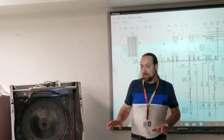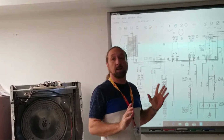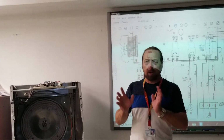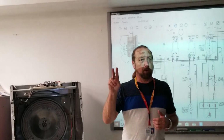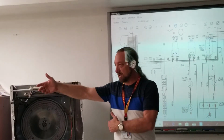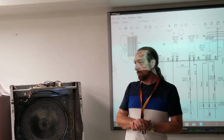Gotcha. I'll give you an example. I still remember this young man. He was working on a microwave. He says it's running and it's not heating. He was just getting into microwaves. He knew enough to test components and everything. I said, do me a favor. Tell me if you got power to the high voltage transformer. I need to know whether it's on the control side or the high voltage side of my problem. I need to know if you got 110 volts coming to the transformer. Can you test that for me?